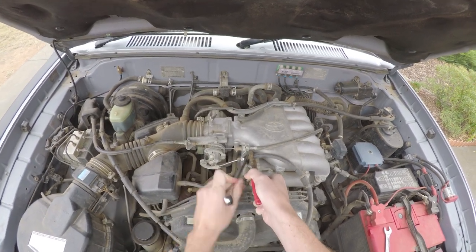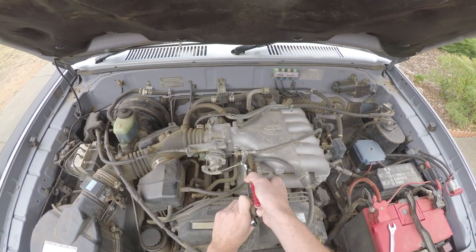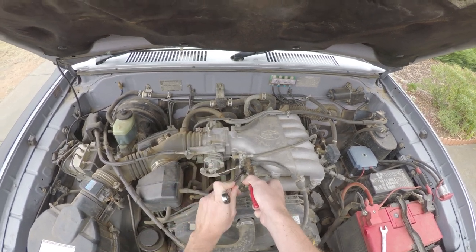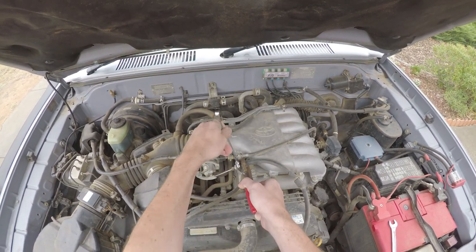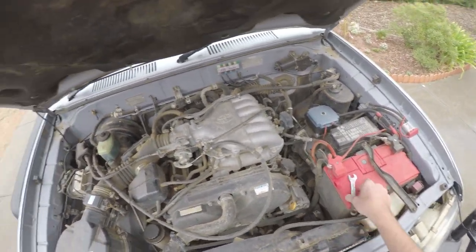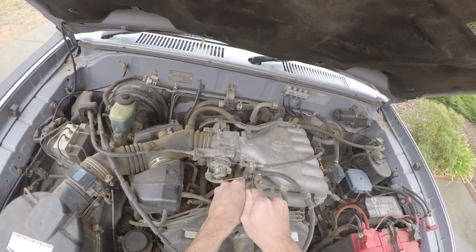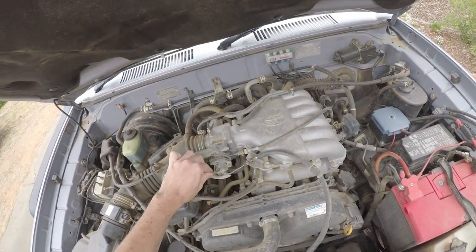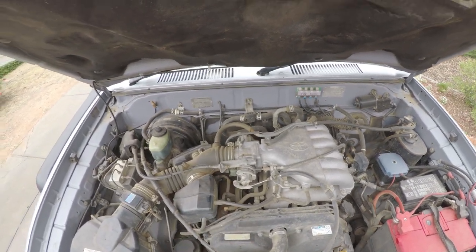And again, you need to hold it once you've done that. Tighten her up. Something you can do at home in the driveway, which isn't a problem. Just tighten her up, get it till it's tight. Just grab your other spanner here, just make sure it locks up properly. And done. As you can see, I've got like no play in that now, so it's nice and tight. So it'll just be like instant throttle response as soon as you pull down the throttle.